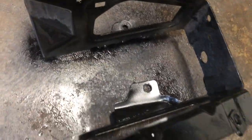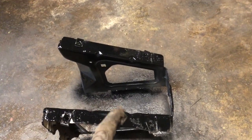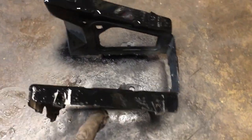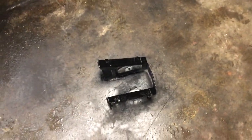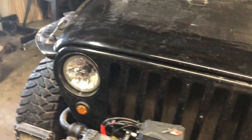I had to make some adjustments to the bracket for the battery box itself. It tends to hold a lot of weight on the battery, and with it just mounted to the fender liner there was some flexing. So I put these tabs back on the back but lower, so it'll still mount to the firewall, and then we're back to knocking out the driver's side.